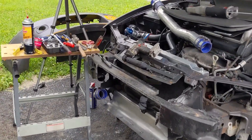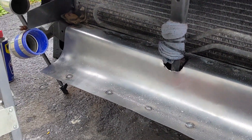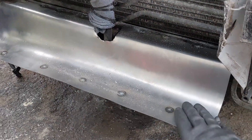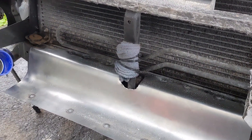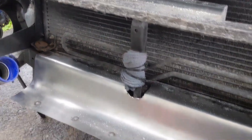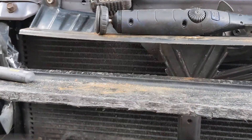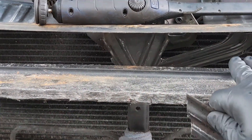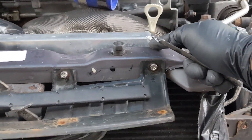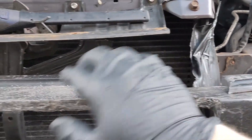It's starting to rain again, but let me show my progress. We have this nice little piece of sheet metal tacked in — nice and strong, not going anywhere. I only did about five tacks on the bottom and five tacks in the back, and protected the AC core with a spare piece of metal bent in to keep spatter from the flux welder off it. I've also gotten one of the hood latch bracket legs cut out, and I'm going to duct it in with another piece of metal up to the edge of the radiator, kind of going straight in, bending up, and closing off like a little cover — but I've got to wrap around the hood latch mechanism.